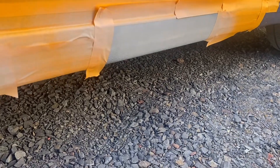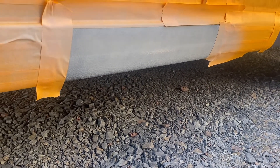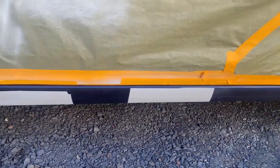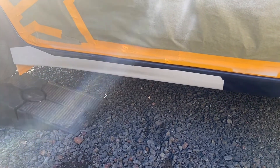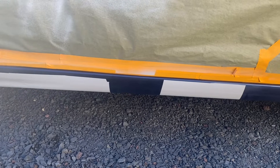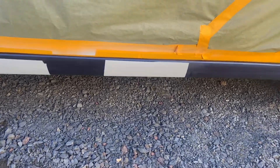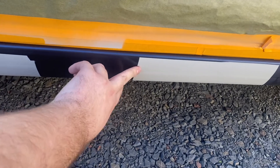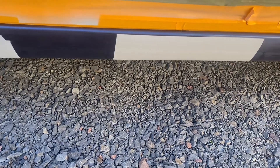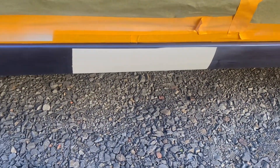I'm not going to bore you with all the other coats, but you're going to think that looks rough — well, like I said, it's supposed to be rough. That's just how it was from the factory. We're going to leave it that way to make it look like nothing happened. So it's all primered out, looks pretty good. Now I'm going to block it with a 600 to kind of shape it and feather out these hard edges, then hit it with an 800 just to smooth everything out. The reason we have to feather out these hard lines is because if you leave that hard edge and paint it, you will always see it through the paint no matter what. So we've got to feather that out.